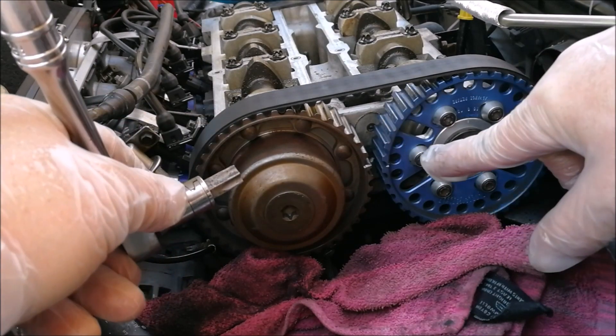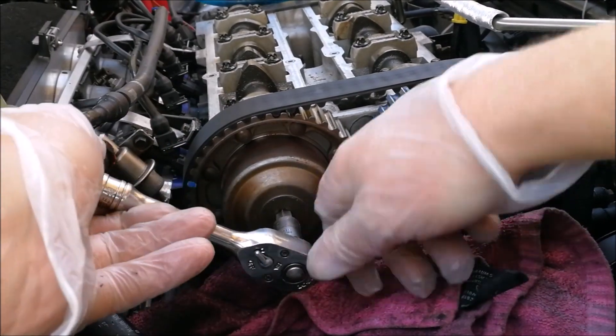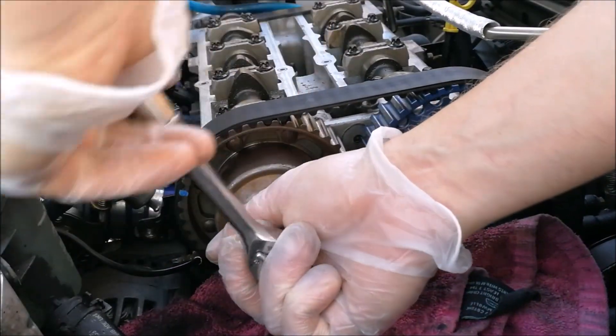The belt is tightened up. I'm now going to remove the cap here - I've got a rag to catch any oil that comes out from the VVT pulley. This is just the oil cover cap, it isn't the actual bolt for the pulley. In this video I undo the main cam bolts without actually using a sprocket or cam sprocket locking tool. If you do this, you are at serious risk of snapping the end of the cam if you're relying only on the five-mil bar that holds the ends of the cam. Don't ask me how I know - I've done it before. So don't copy me: make sure you get your cam sprockets held with a locking tool or some other type of grip on the cam itself. You've been warned.